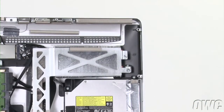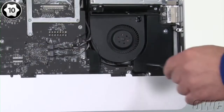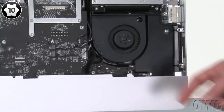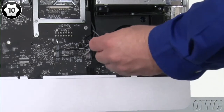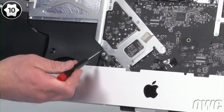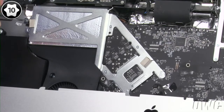We'll need to remove eight Torx T10 screws to detach the logic board from the back of the iMac. The first screw to remove is next to the graphics card heatsink. Next, remove the screw near the bottom of the iMac, then the one just to the left of it, which is hidden behind the audio cable. These two screws are shorter than the other logic board screws but longer than the heatsink screws. After that, remove the screw next to the fan, then the screw in the middle of the logic board, and the one near the lower left corner. The next screw is located in the heatsink frame, and the final screw is on the far left side, holding the heatsink in place.